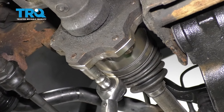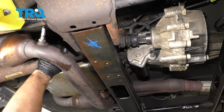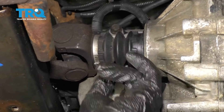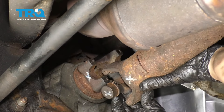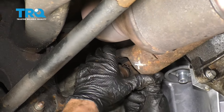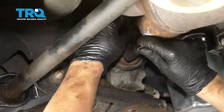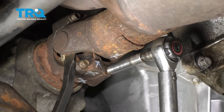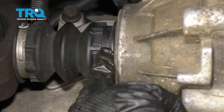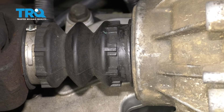Now take the front driveshaft and just slide it over that crossmember and the exhaust, and slide it into the transfer case. Push that boot on there, and then slide the front U-joint into the yoke. Try to line it up with your marks and put these caps on. Now I'm just gonna use a pry bar to prevent the drive shaft from spinning, and torque these bolts to 18 foot-pounds. You should get a clamp that goes on here — pretty much like the clamp that came off. There's a metal clamp, or some people actually use a wire tie on that. That works as well.